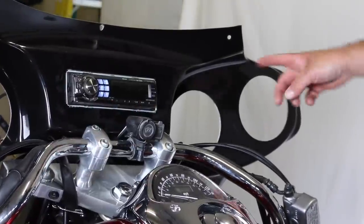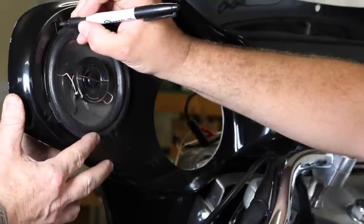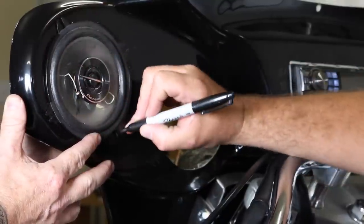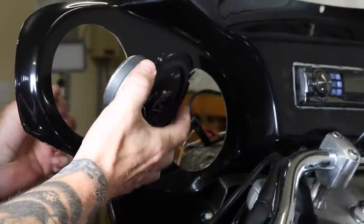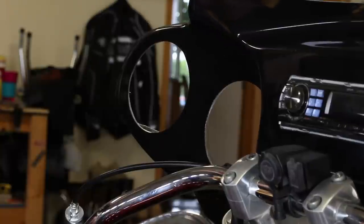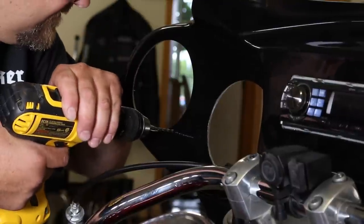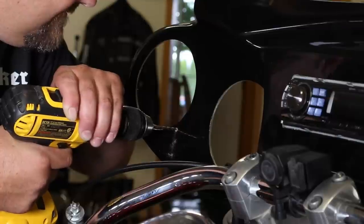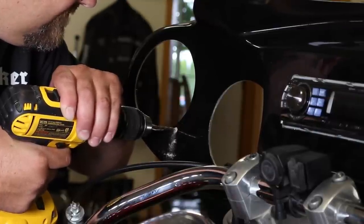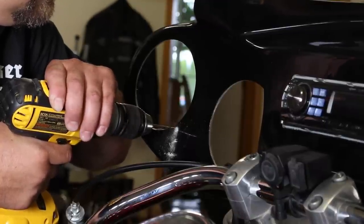Once they are all loose, the handlebars will roll down out of the way — voila, now we got lots of room. Ryan is holding a speaker up in place on the fairing and Kevin's going to make some marks where we want these holes drilled so that we can put the bolts through and hold the speaker on. Kevin just brought over two speakers today so we're just mounting up two — he'll mount the other two later. We've got our holes marked on the fairing, Kevin's got his drill bit, and he's going to drill four holes in that fairing. Remember: if you run the drill backwards, it doesn't grab onto the fiberglass and rip it all apart.